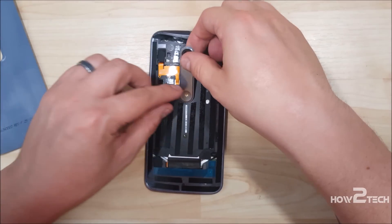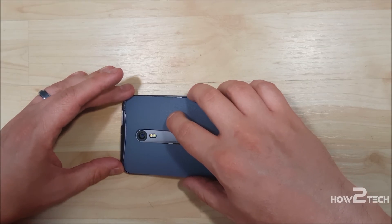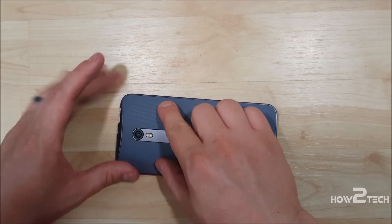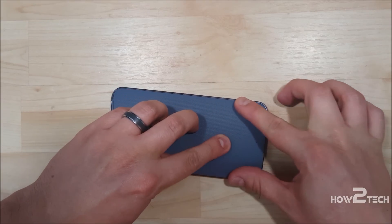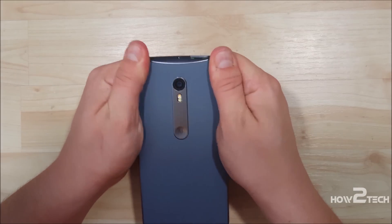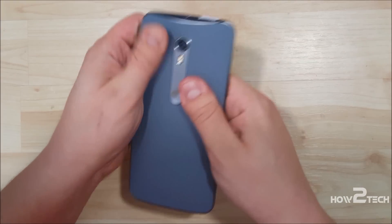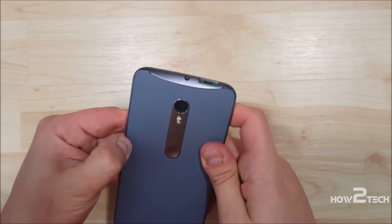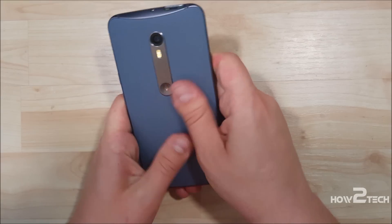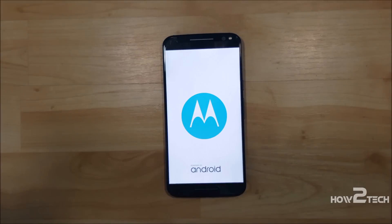Now with that done, take the dimple and put it on. You could put some adhesive around the edge of the dimple, but it should be just fine without it. Align the top edges first, make sure the dimple is centered, then work your fingers down the back of the phone so the bottom fits in. Rub all the way through the middle and around the sides — anywhere you put tape, make sure it gets good adhesion. Now power on your phone and make sure it's still going to function properly. We got this repair done. If you have any questions, throw them in the comments, and if you found the video useful, hit that like button. Thanks for watching — catch you in the next one.